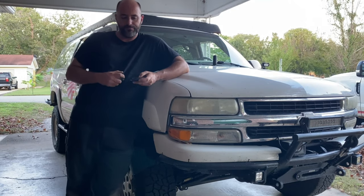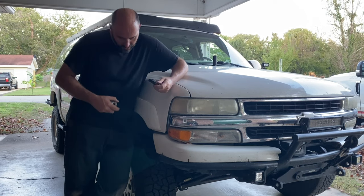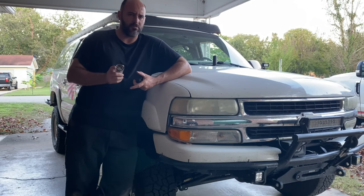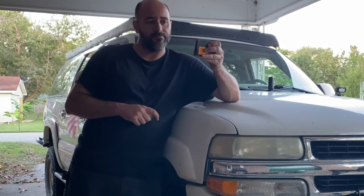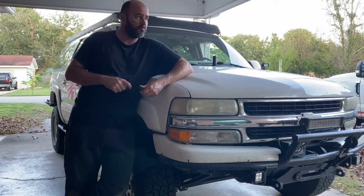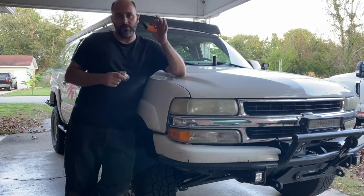So in this video, I want to replace the passenger side axle seal at the center axle disconnect. This one sprung a leak after breaking the knuckle, and I guess it put some pressure on it. I don't really know, but it started leaking after that. And I do not have the correct tools to install it, but I usually make a lot of my tools anyway. So I'm going to use a hole saw to install this seal.